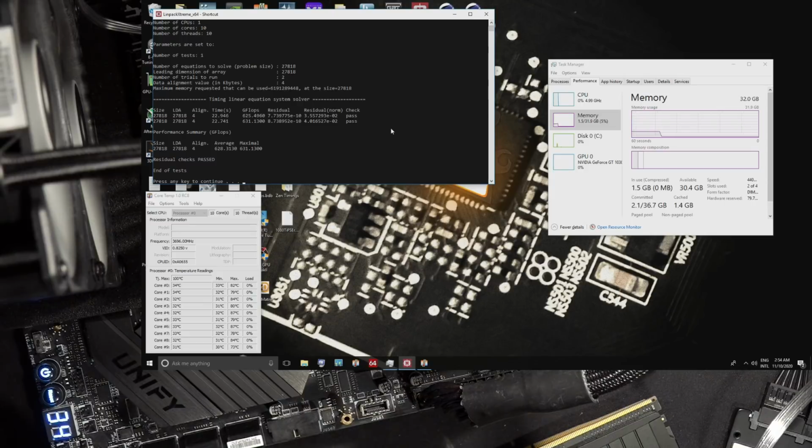Generally, you would want to tune the timings to the limits of each memory configuration individually, but then we'd be here all day, and I don't feel like doing that. And then also stability starts factoring in, and honestly, even this is probably not completely stable. 6 gigs of LinPack is not a stress test, especially when you only do 2 loops. Anyway, that's a 628 for dual rank on 4400.